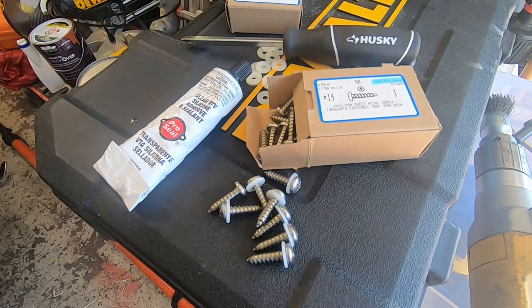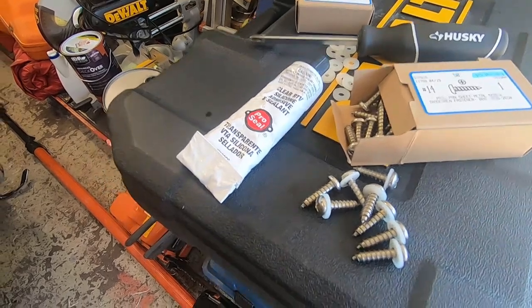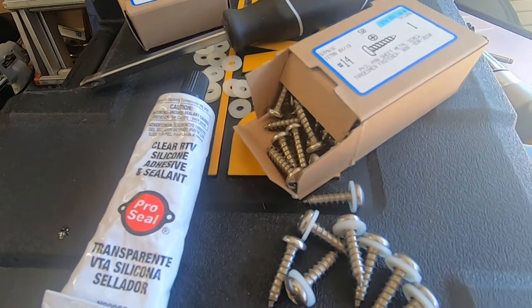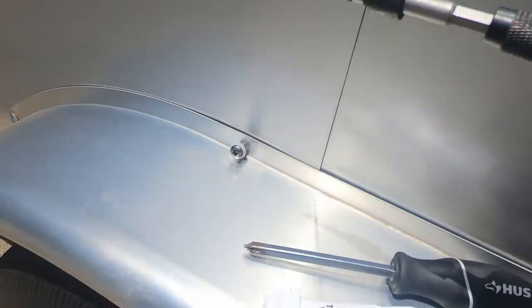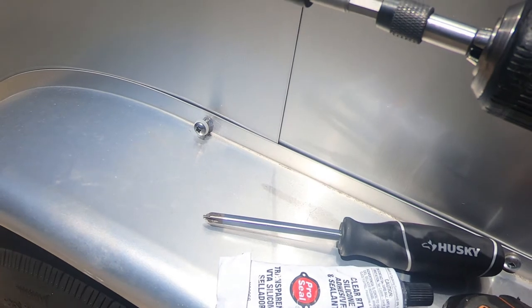There's our first one installed. Now we'll get on and get all the other ones done. I'm going to replace all the screws on the fenders and whatever ones I find that are rusty on the uprails. There are eight mounting screws for each fender on each side of the trailer, so with the first screw already in, I've got seven more prepared. I'll take out every other screw still on the fender and replace them with the new screw with a little dab of clear silicone. I started the new screw in with a screwdriver and I'm going to finish it off with the power drill.